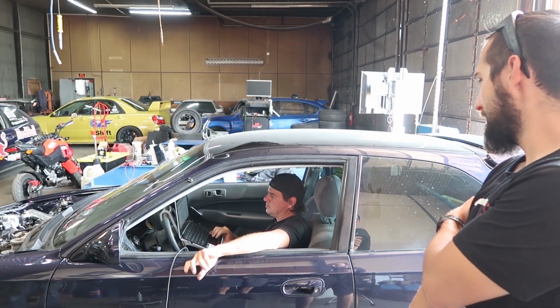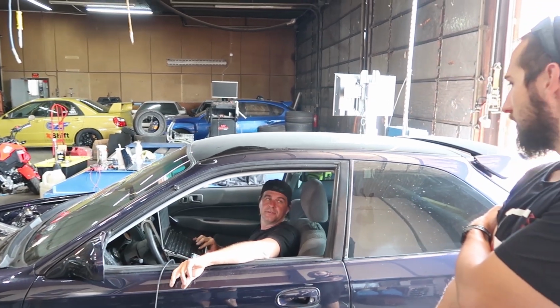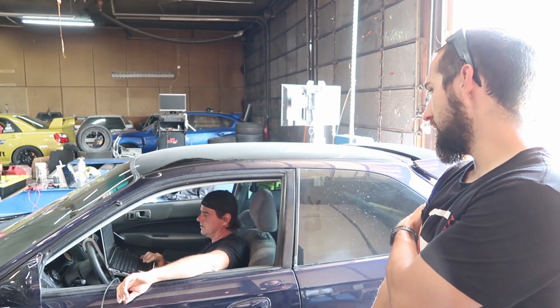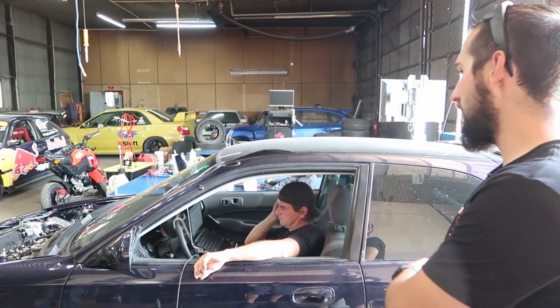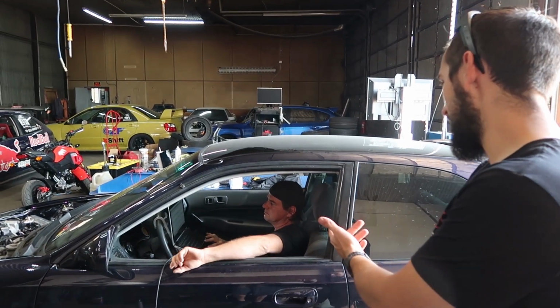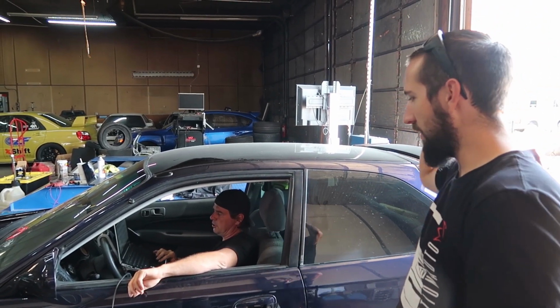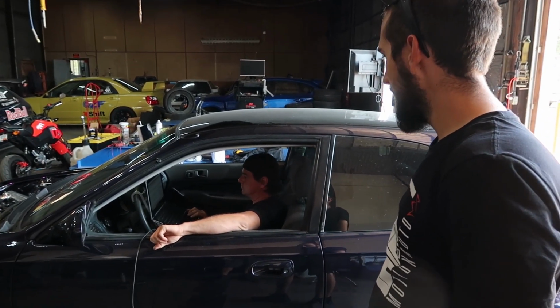So we got 2 pounds of boost at 4,600. And it's almost good because it's kind of keeping the power out of it. Yep. I had a 63 A/R housing I thought about putting on it, but we talked about it, and it's almost better to keep it bigger. Yeah, especially on a stock motor, where you don't have all the back pressure and the heat. Get it out of there.